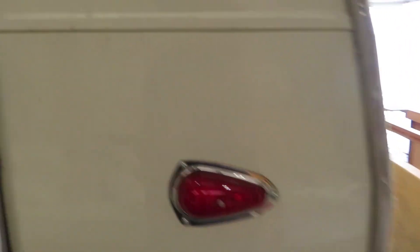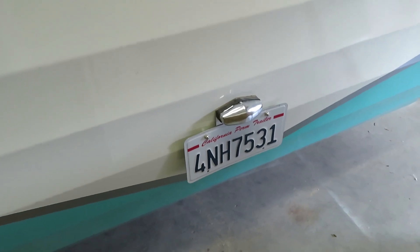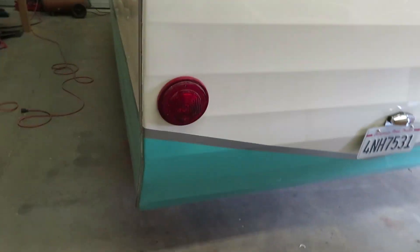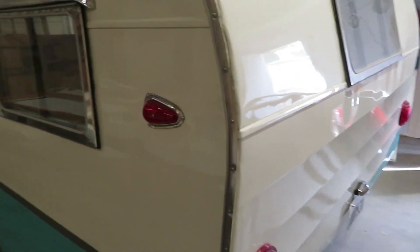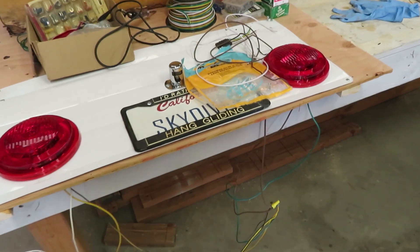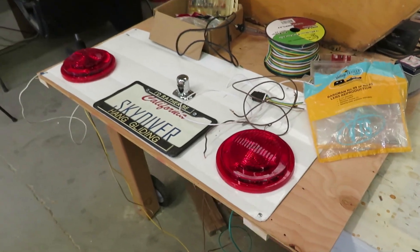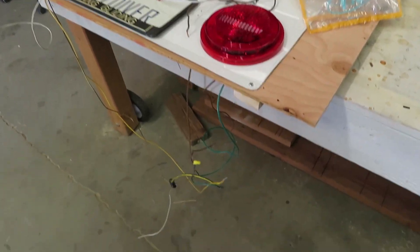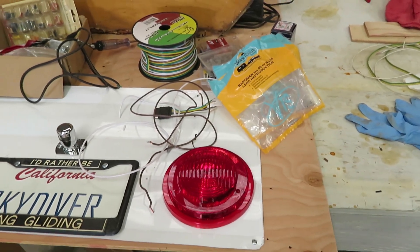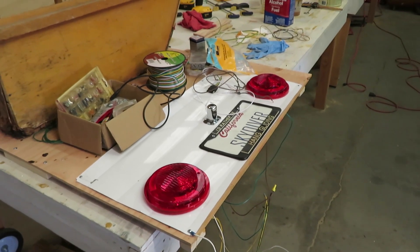This is how I'm teaching them about wiring for these vintage trailers so they don't electrocute themselves and so all their wires, lights, and everything works the first time. We've got marker lights, tail lamps, and a license plate light. Some people even have three or four or five marker lights up there. All that stuff has to be pre-wired before the metal goes on — if you don't know what you're doing it's kind of tough. So I'm teaching my students in a way they can understand rather than schematics and diagrams on a whiteboard. I'm doing it right in front of them, talking about what color wires I'm using, why I'm using them, where they go — and I light it all up too. It's a really good teaching aid.